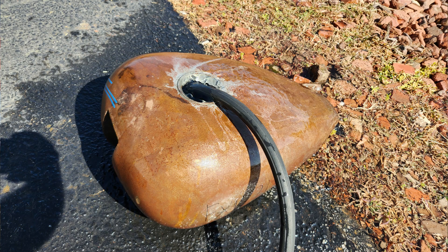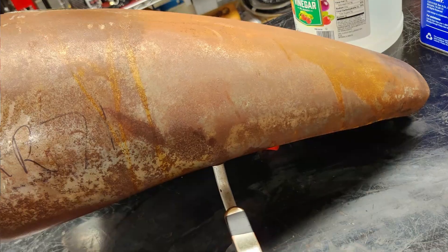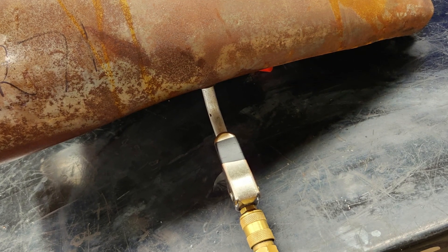The second the muriatic acid is poured out, pull the plugs out of the bottom, put a water hose in, turn it on wide open and let it flush. Once that's done, drain the tank again and pour in MEK — methyl ethyl ketone — which you can get from any paint supply store. Acetone would work as well, just doesn't etch quite as well as MEK. Pour in about a gallon, shake it around for a couple of minutes, drain it out, then put an airline in the fuel valve bung and let the air circulate through it for about 10 minutes to get it completely dry.